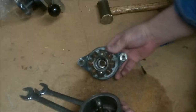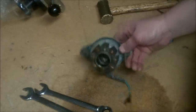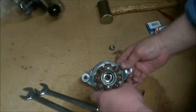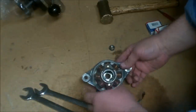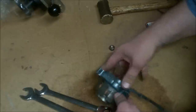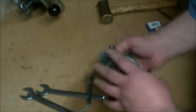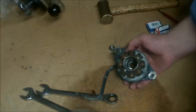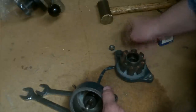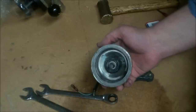These are very, very strong rare earth magnets. Here are your windings — there's one, two, three, four, five, six, seven, eight of them. What you want to do is look for burn spots. Like I said, I just don't have any problems out of these electrically — there are no moving parts. This rotor or flywheel that houses these rare earth magnets is pretty much indestructible.